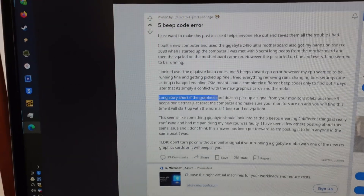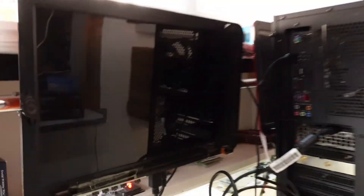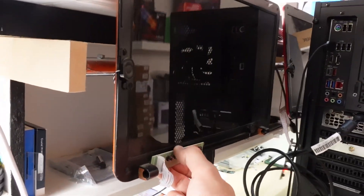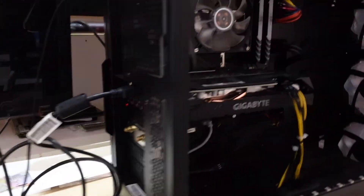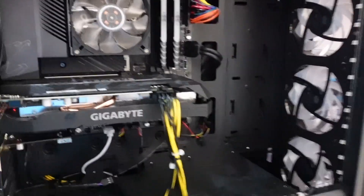He essentially boils it down to being the graphics card not picking up the signal from the monitor. I had it connected up to my very janky 15.6 inch laptop display using the converter board on the back. I left the computer on for probably about five minutes, and eventually it got synced and those beep codes stopped — now it's starting up perfectly fine.